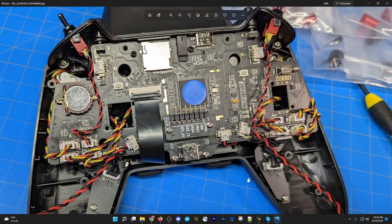I disconnected these connectors right from this secondary board down here rather than from the underneath side of this board. When you flip this board up — unfortunately I don't have a picture of it — there is one more connector on the backside of this board that goes to the power button. So be careful not to just pull things apart haphazardly; go slow, be tedious about it. Also note these screws are removed from the outside, not inside. When putting it back together, another mistake I made was putting the screws in and I couldn't get the shell cleanly shut — I needed to take those back out because they insert from the outside. The ribbon cable: this thing flips up, you slide the ribbon cable out. It's pretty foolproof as long as you're not heavy-handed. Go slow, be tedious. Don't pull on the wires — pull on the connectors. Don't jerk the ribbon cable out; flip the little release latch up and then slide it out nicely. Treat your equipment like you want it to be treated so you can use it for years to come.